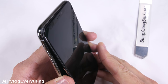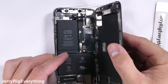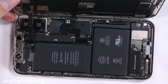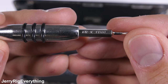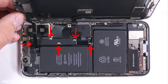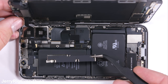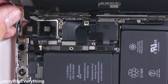When the screen is mostly free, it doesn't pull down this time to unlock, but instead just folds right open like a book. The ribbons you see on the right side of the phone are extremely fragile, so don't put any pressure on them. Apple did simplify the process with only one metal bracket this time, which is nice of them. Still using the same Y000 screws as previous iPhones, I'll remove the five screws holding that metal plate down, and then keep them organized off to the side because they definitely need to go back in the same hole they came out of. It was also nice of Apple to put all the connectors in one solitary row for us here in the center.